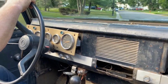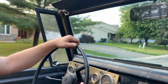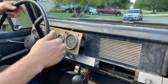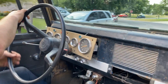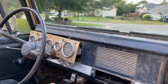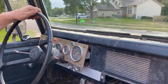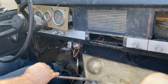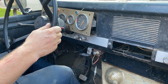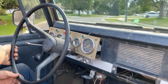You know why? Oh, why what? You know why I couldn't shift? What, a downshift? Yeah, you couldn't downshift? What's that? Throttles. The return spring needs to be stronger on this. I can feel already. Oh, yeah. Those brakes? You've got to press on them, that's for sure. Yeah, I think we've got to bleed them just a little bit more. I don't know how much gas you have either, so I'm not going to do anything crazy. I mean, you would have heard me if I'd done anything crazy.